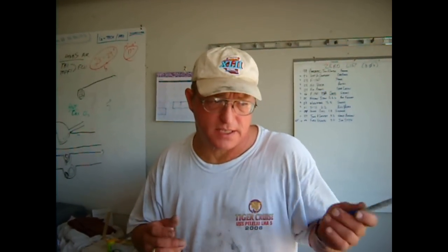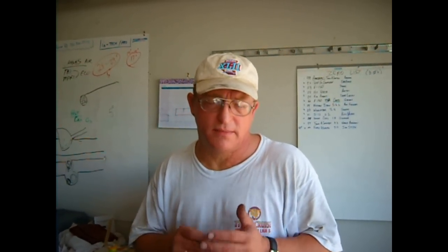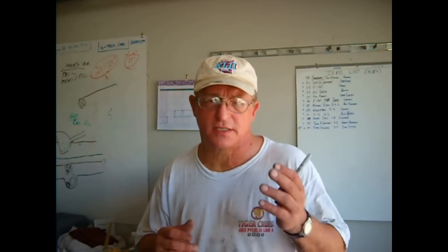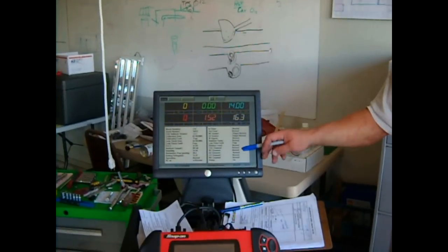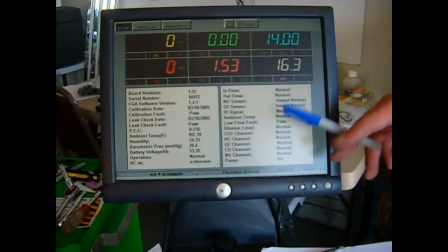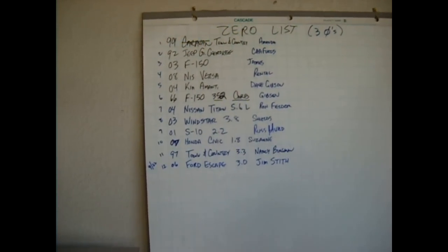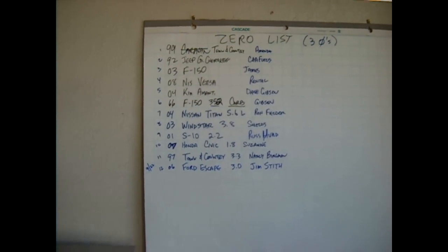In addition to that, we did a modification on the vacuum system — all we did was disconnect and cap the PCV port. It already has a crankcase emissions ventilation line that runs to the intake airstream, so it's a redundant system that only detracts from engine efficiency. As you see from the numbers here on the screen, this is live happening as you watch it — this vehicle is running tremendously efficiently. Looking over at the board, we've got 12 vehicles, which we have done what would be considered impossible in many shops today. But not here in Gadget Man land.